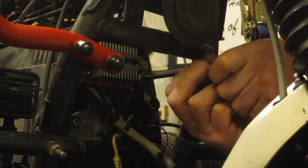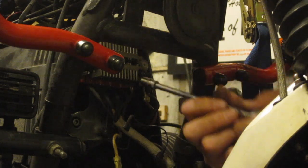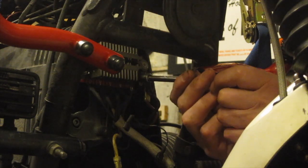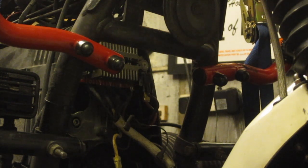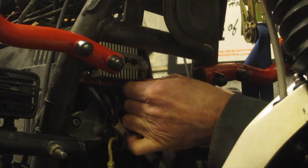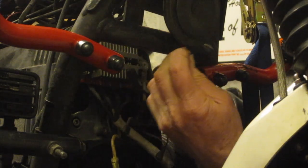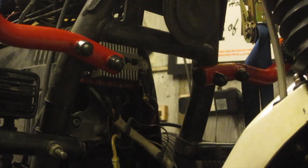We've just done the lower left hand mounting. Like the other side at the bottom, it has an earth strap that links to the alternator body, the stator body. So that's the other earth strap. And now undo the top one — need the UJ to access that.